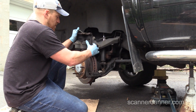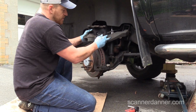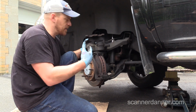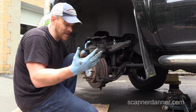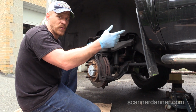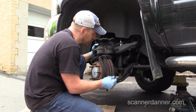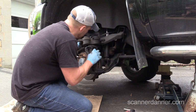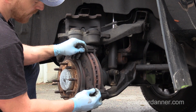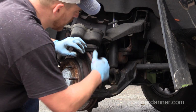All right, front one. We'll do that piston check again, although these moved freely, so you know what, I don't need to. I don't typically take a caliper off and go inside and hit the brake pedal. That's not something I really ever do. The reason I did in the case of the back one is because there was no other evidence of it being frozen. In fact, maybe we do need to do it with this, because look at this, Caleb. See how nice and free that is? Right? Mm-hmm. That's good. That's what we want.